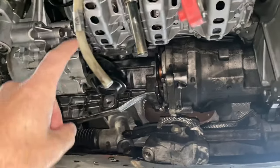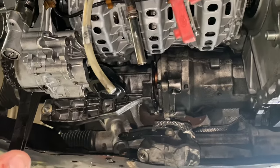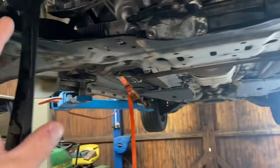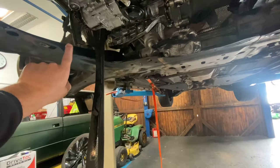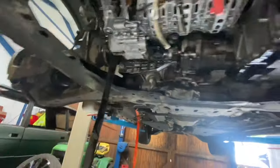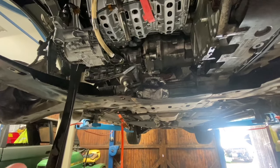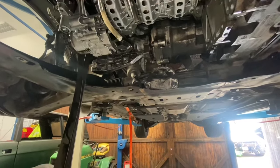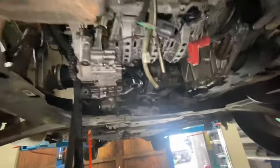That's the oil pump all back in there, and the baffles back on. The little electrical pump there in the oil pump - that's all back in there bolted down. We're just going to have a dry run with the sump. Chris took all the bolts out of the subframe and we've got it strapped up, pulling it back as far as we can, with the engine stand underneath holding it up. We've pulled it back just to give us that bit of extra room where we were struggling last time. We'll finish the rest off camera as it's just the reverse process.